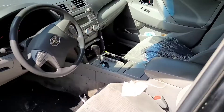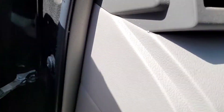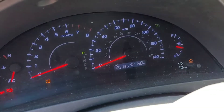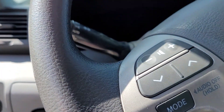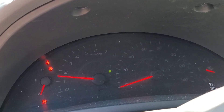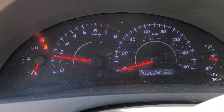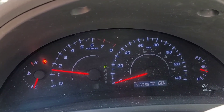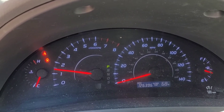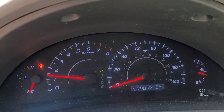I'm going to come back in 30 minutes and see what we've got. All right, 30 minutes is up. Lights are still flashing — I guess that's okay. I'm going to reach underneath and pull that wire out. Key off, key on — look at that, it actually runs! So I learned something new today. Supposedly you've got to leave it running for about 10 minutes because it needs to relearn idle and some other stuff. I'm going to do it, because what they told me before actually worked.